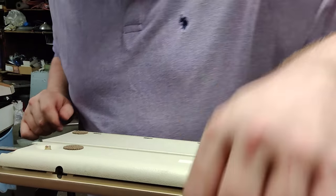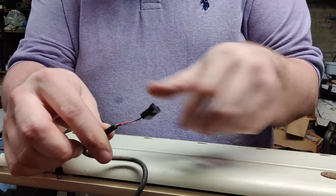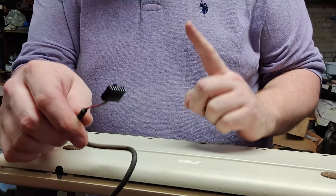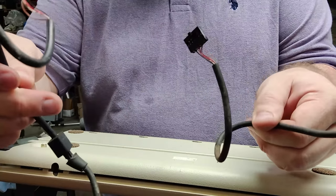We're actually going to replace the controller. We're going to plug in what's basically a glorified adapter that goes from the old XT electrical signaling to modern USB. There are a couple of versions of this keyboard — it could be AT or XT. This is an XT version, and that changes the software that you need to load.